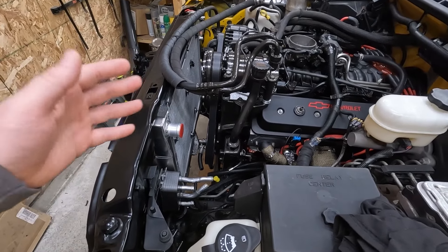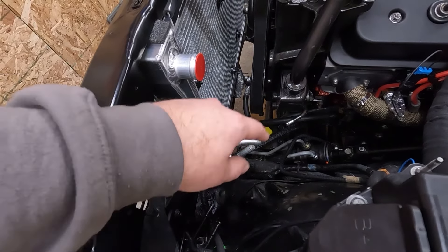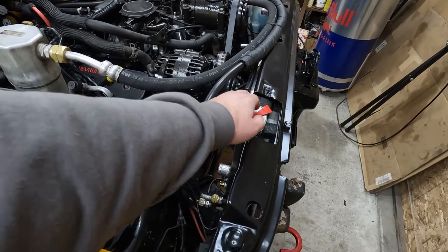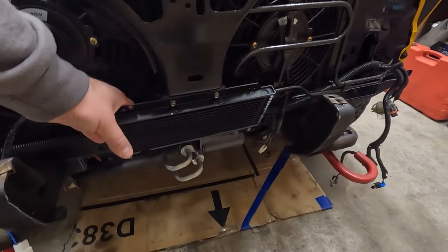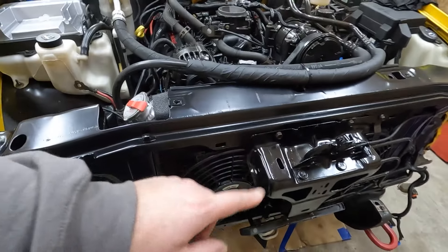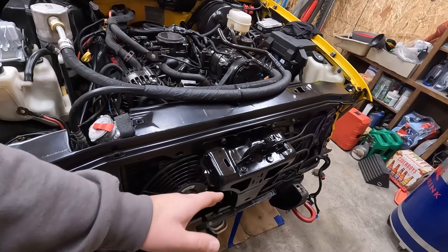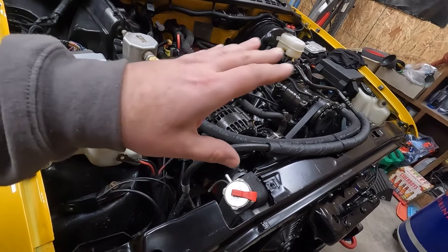I still have to hook up the power steering lines and I'm adding an inline filter while I'm at it — just mashing more stuff in here where there's no room. On the passenger side, I have our in-radiator transmission cooler with fittings figured out, plus a small external cooler on a thermostat so it only activates if needed. Same idea as the oil cooler — we don't want the fluid too cold, but this acts as an emergency backup if things get hotter than the radiator cooler can handle, similar to how larger trucks are set up.